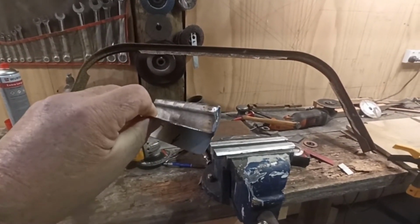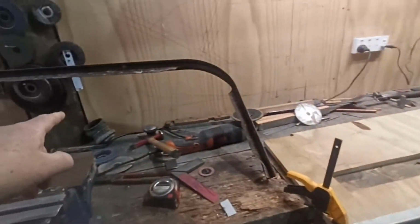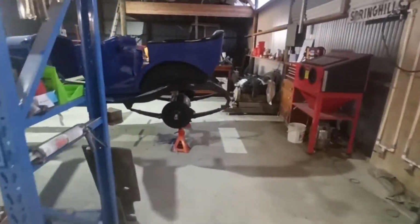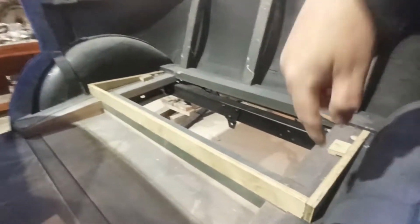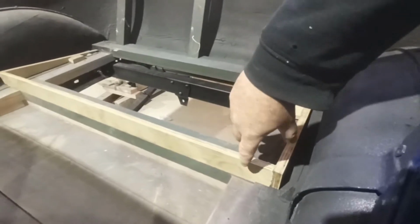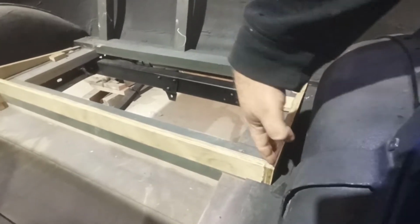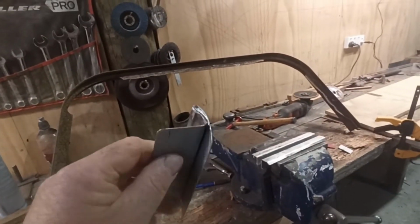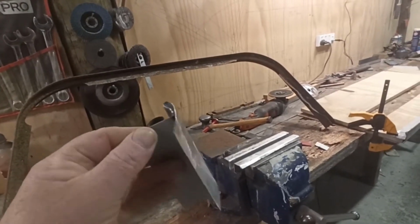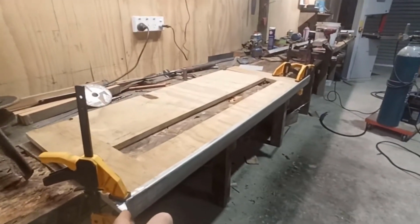And then I welded up the end of it just to make sure, because I was a wee bit worried about the way it's cut off here and it's flat and doesn't go around like that, obviously because the front seat is open on the sides because of the door, but the back seat's not. So it's just got the trim across the front because the rest is all upholstery. But I was a wee bit worried that if people were lifting it up and down and this upholstery was close, which it will be, it might catch and rub and cut over time. So I was trying to avoid that. So we welded the edge up like that and then rounded it off, and hopefully it won't cause any damage. That's my plan. So that's what I've done.